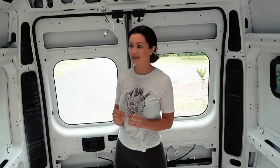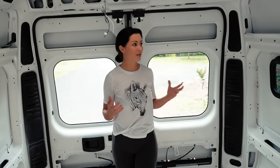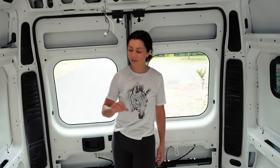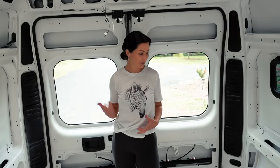Welcome to another video. I'm Elisa and I'm converting my 2021 RAM ProMaster. Today I will be installing Killmat sound deadening sheets on the walls, the ceiling, and the floor. These sheets are supposed to help reduce the sound that comes into the van and out of the van. They say just covering about 25% of the van is enough, but I will completely cover the wheel wells because this is where a lot of the sound is produced.